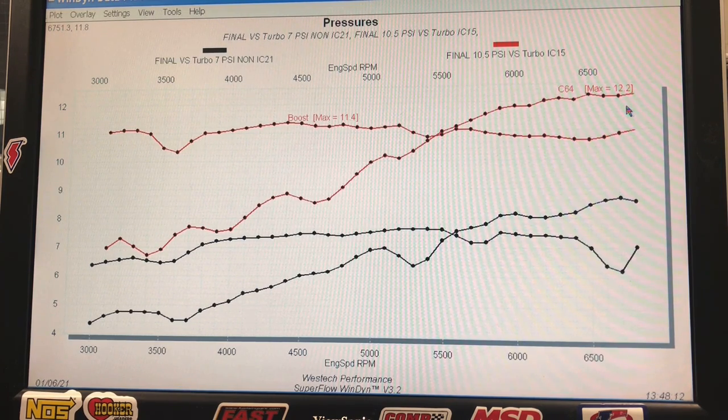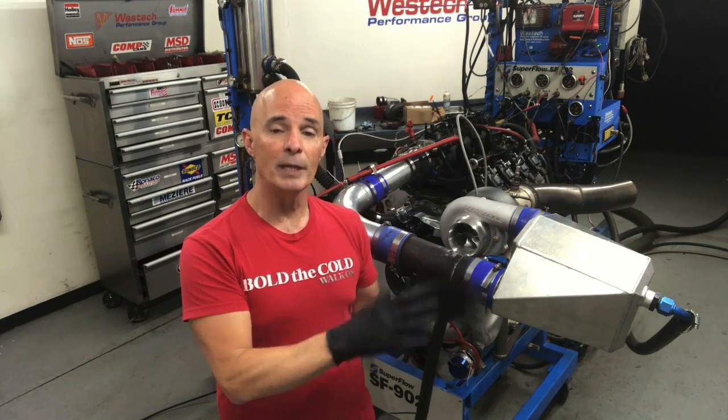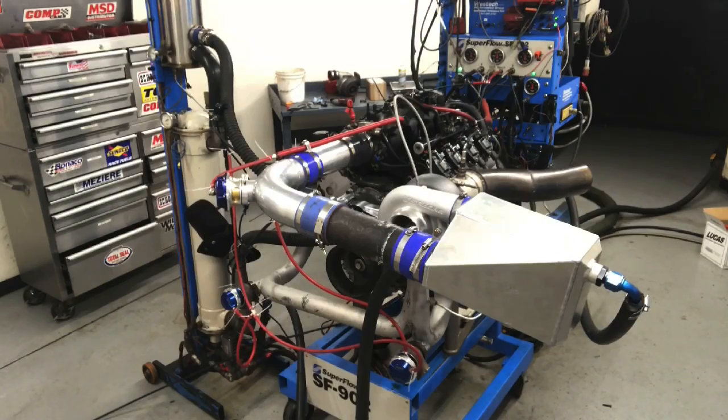Okay guys, what's the takeaway from this test comparing intercooled versus non-intercooled on our E85 4.8 liter? There are two things: first, intercooling always works — whether you run pump gas, E85, race gas, or methanol, intercooling will always cool the charge temperature, and a cooler charge temperature is always better. But the flip side is that running E85, especially at these boost levels, works so well that you can always turn the boost up just a little bit to make up the difference between non-intercooled and intercooled. I'm Richard Holder, guys — thanks for watching, make sure to like, share, subscribe, and ring the bell. Lots more 4.8 turbo testing coming up.